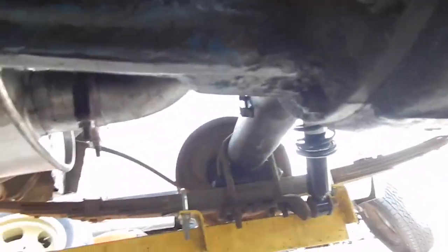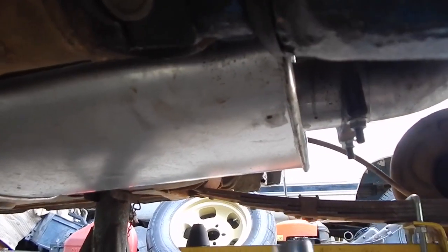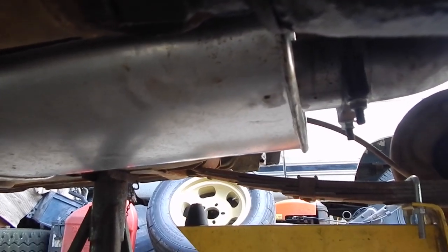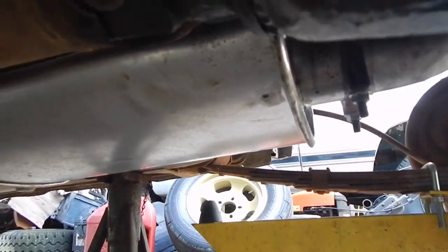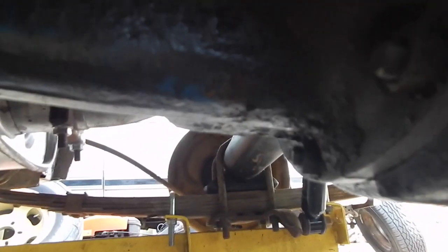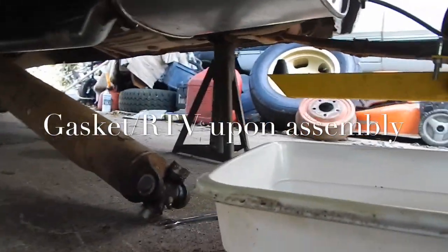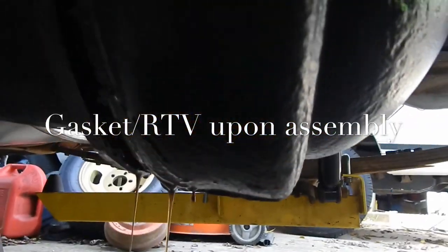We're under the car. Here's what I've got to do — drive shaft. I think it's a three-eighths; hopefully it's not a 5/16ths, I didn't bring one underneath here. Car's in neutral so I can spin it around. Got four bolts here that hold the straps — two bolts per side — then I just push it forward and let it sit on the ground. Then I've got the bolts around the differential, ten of them, nine-sixteenths. You're gonna get grease out of here and a heavy center section, about 75-80 pounds. Drive shaft's off. The ten bolts in here are loosened and I'm just draining out my differential grease.